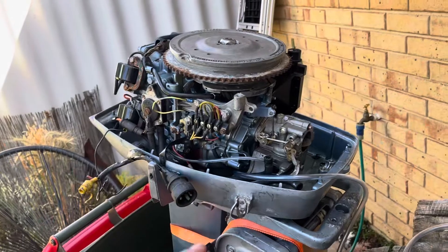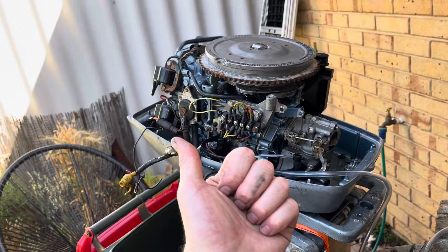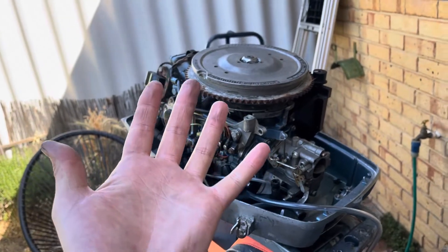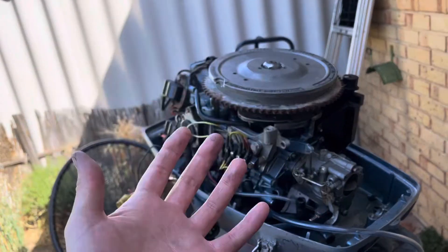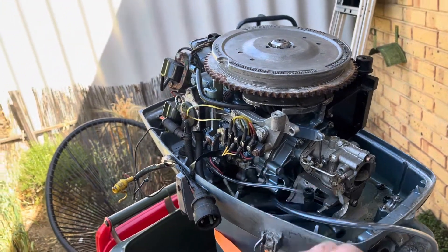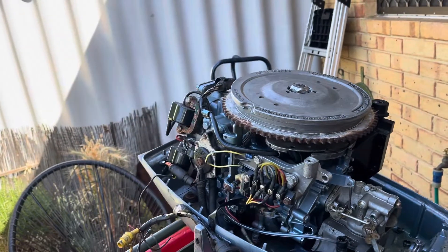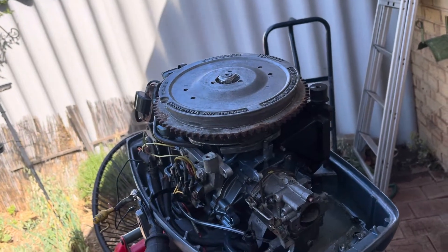So yes, lots of things are missing, but an engine really just needs a few things to run. It needs fuel in the correct ratio, it needs spark in the correct timing, and it needs compression. You also need to make sure the valves are timed correctly. With a two-stroke they're ports, but it's still really important — in this case it's a reed valve. If the reeds aren't closing, it won't run. And if you're working with a piston port engine, if the piston is worn and not sealing the ports, you won't get that either. So it's not just compression, fuel and spark — it needs more than that, but that's the basics.